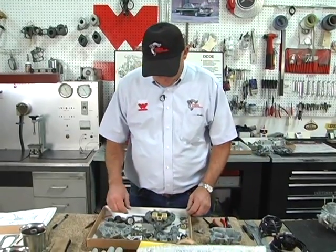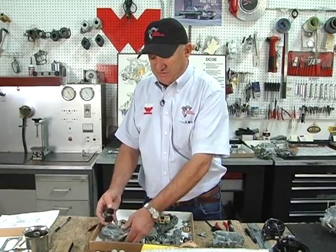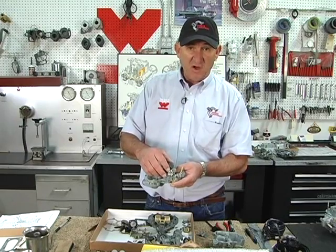The other thing that's important is fuel pump pressure. These carburetors like 3 to 4 pounds. You get on the gas, you run down the road, the car runs great, it gets up to 4,000, 5,000 RPMs, and it flattens out. You have a tendency to want to raise the fuel pump pressure if you have a regulator. You can't. If you push the fuel pump pressure up into the 5, 6 pound range, the pressure on the needle and seat sinks the float.